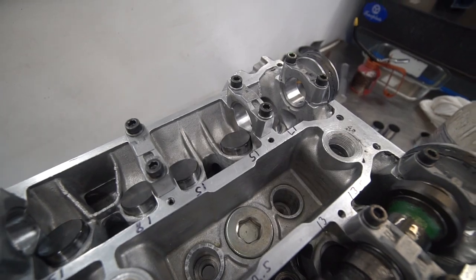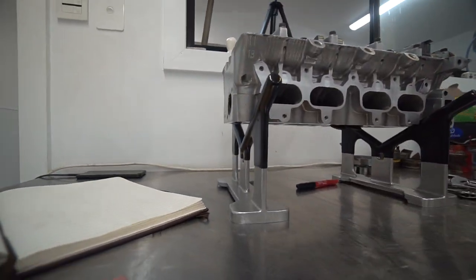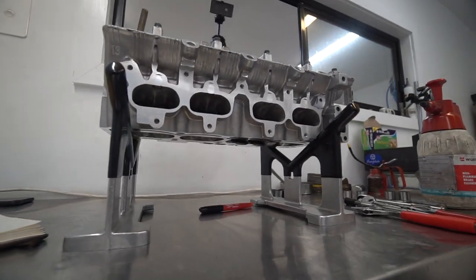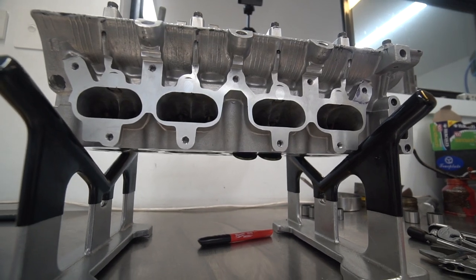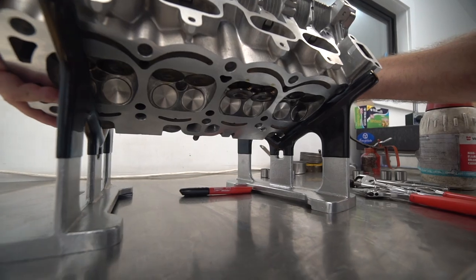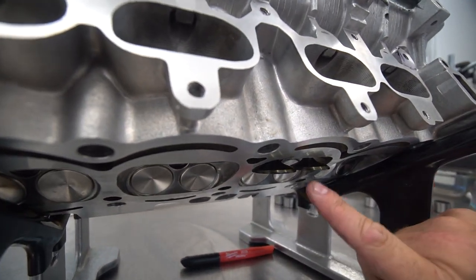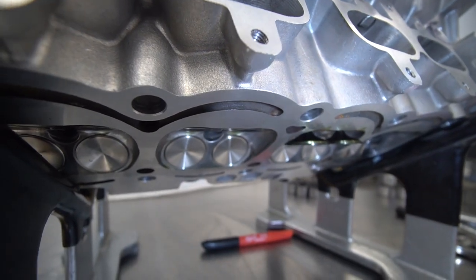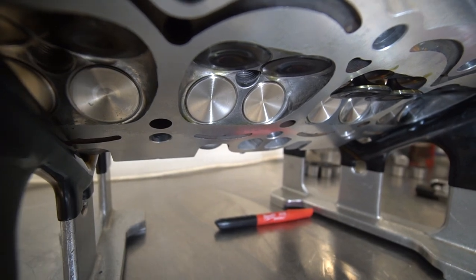So you can actually see how much valve's coming out. Remember yours, the valve head was completely all the way out. But these ones are visibly bigger than mine. Yeah, the valves are physically bigger. If you come over, you can see the beryllium seats up under there. Everything's covered in oil, so that's why it looks green.